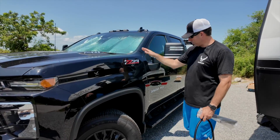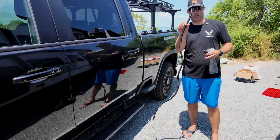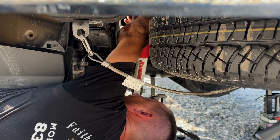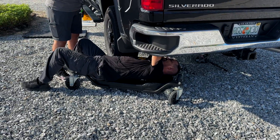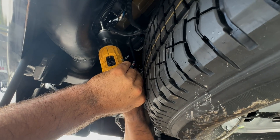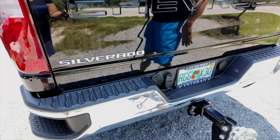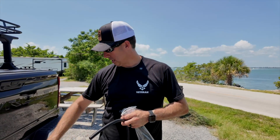The wiring came straight across, then down, then along the frame rail of the truck — secured with wire loom and zip ties the full length. We had to pull out a fiberglass fish tube and run it across the top of a small hole over the gas tank, which was probably the hardest section. Once we got it past the gas tank, we came out to the back of the truck. Finding a spot to mount the Anderson connector was a challenge — we needed aluminum or sheet metal backing so it could be firmly mounted, close enough to the 7-way pin.